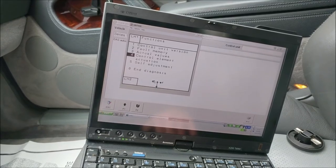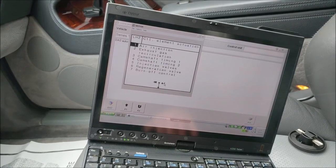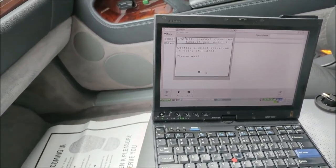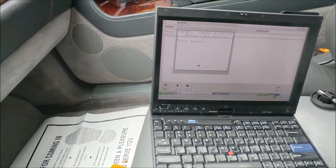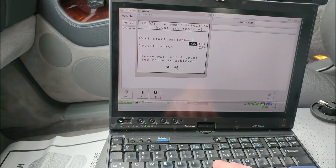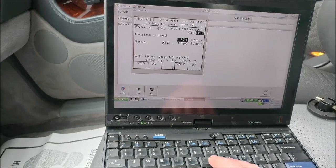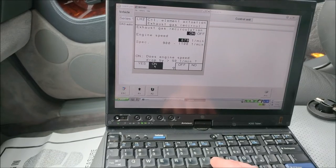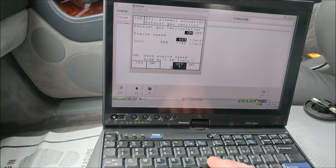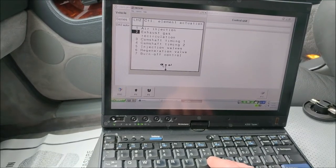We're okay - probably forgotten, somebody did some work and forgot about it. Let's do EGR on the secondary side. Just have to check out the actual valves. Okay, temperature is reached, post-start enrichment - on: 750, 690. Oh yeah, I feel it right away - the engine is just starting to shake, very unhappy. This one works for sure.